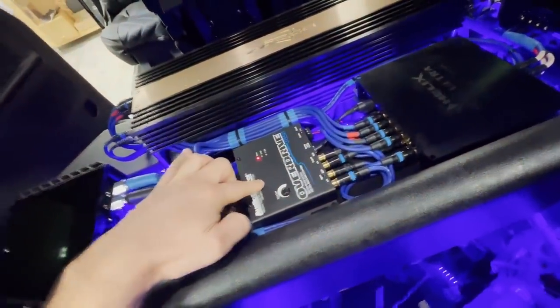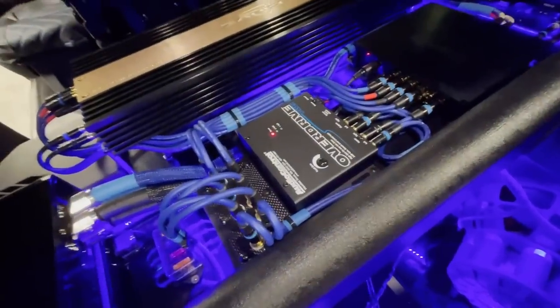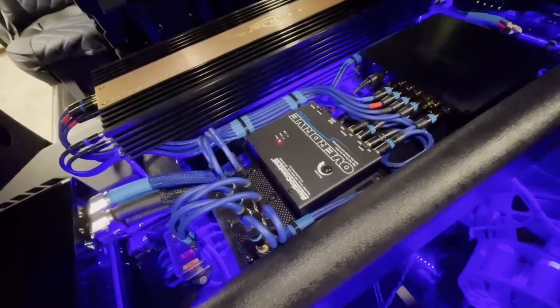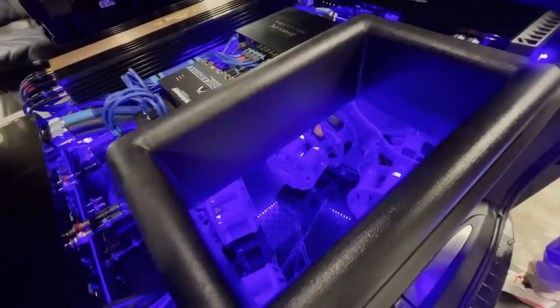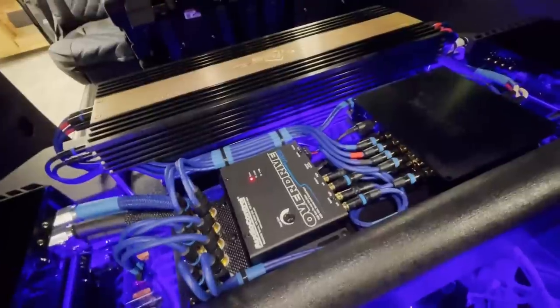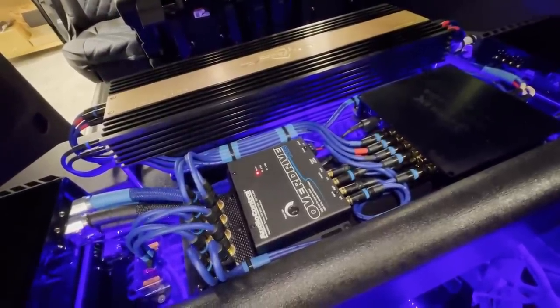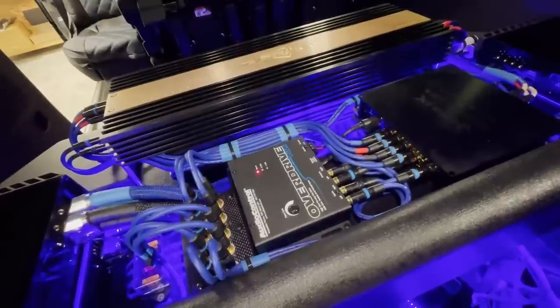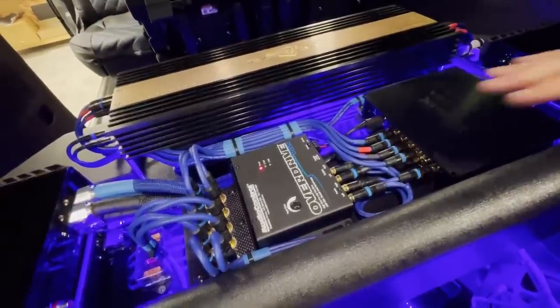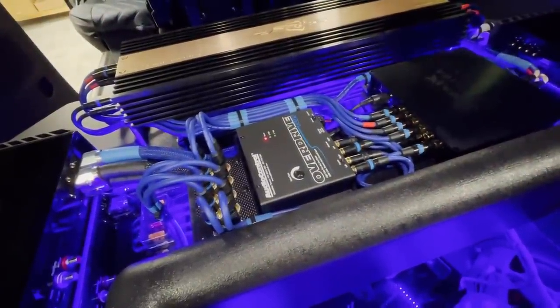And now, Henry, you have to explain what this one is doing here, because I'm not too sure why you needed the audio control. It was over the top. Because there's so much bass involved, I wanted a device that I could instantaneously use to turn down the bass or adjust the bass volume without having to go into any menu or press anything else on the Helix. Instead of switching on screen between the sub and the main volume, I wanted something straight there in front of my Helix. So you have a physical knob up front, which is easy. Plus once these are all balanced, we can just adjust the single gain, which will control each one of them together as one. Nice and simple.